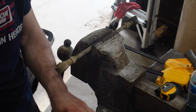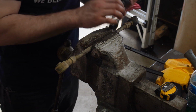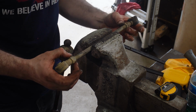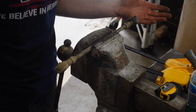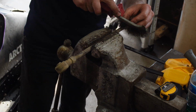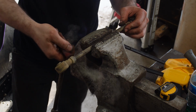I'm gonna take everything out of the bag so I can see what I got. And I'm gonna compare these to make sure the centering is the same. And then I'm just gonna take these off, loosen these jam nuts, put the new ones on right where the old ones were, and put it together and see how it is. These threads look decent, so I should be able to clean some of this dirt out of here and be able to align it easily if we need to, so I'm ready for that.